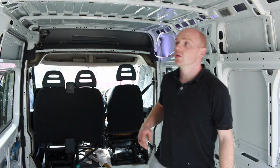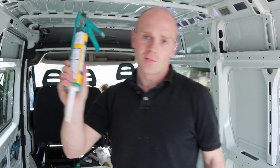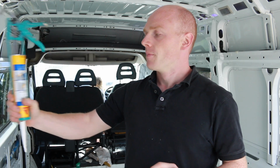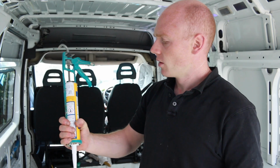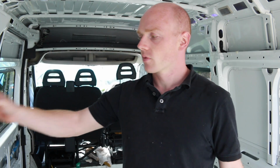Right, job done. That's all, I used one tube. And this is another one of those things that sometimes you forget to budget in: the amount of this adhesive we're going to get through. There's two grades, one's more of a sealant and one's more of an adhesive. 221 and 5 something. This is the multi-purpose screw fix version, but yeah, Sikaflex or Tiger Seal is another one.